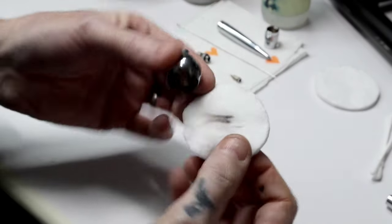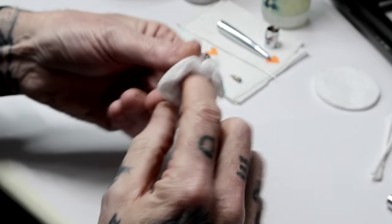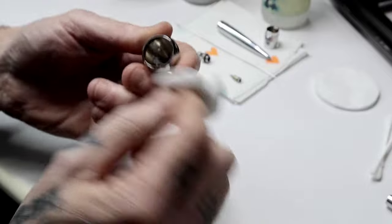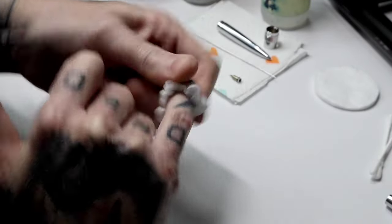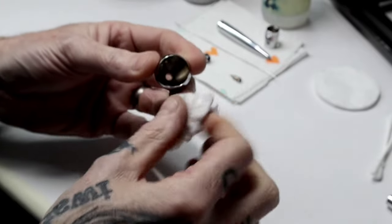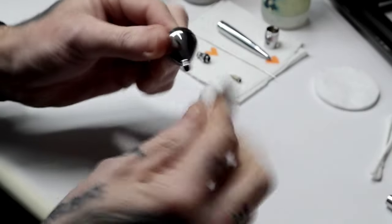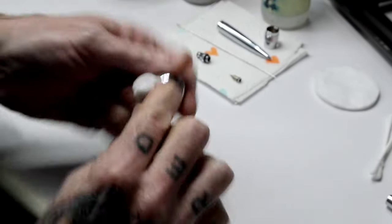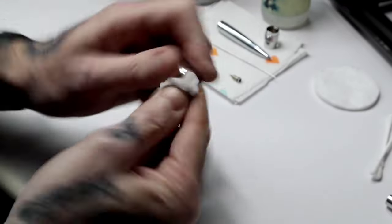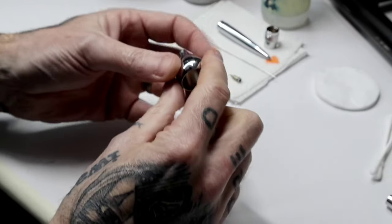You can then use the same pad. We've got some leftover paint in here, so you can put your cotton wool pad in and wipe inside the cup just with your finger. This is stubborn paint that's dried up in here, but it is coming off with the thinners. Give your cup a wipe through like that - so that's your cup nice and clean.